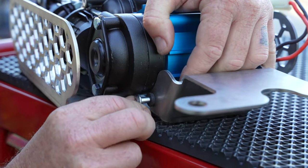Hook that one up there so I can move up to here to grab it. Gets a bit awkward, this bit, but not too bad. Then you want to try and eyeball it and try to start the nut set. I think I've lined him up. I'm just trying to get the nut started. He's done it! So as you can see now, we've got both our air filters up there. Grab yourself a 13mm spanner and get in here - righty-tighty, lefty-loosey, legends. Do not forget it.